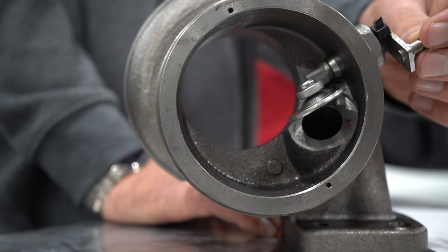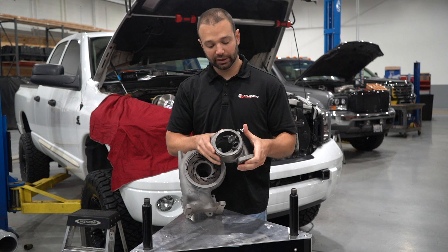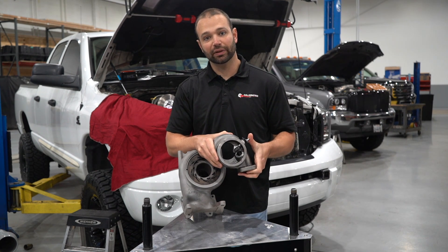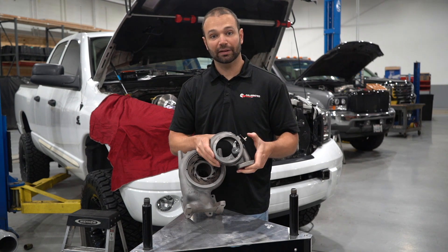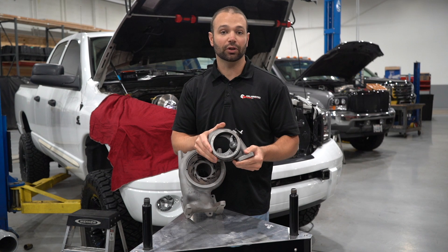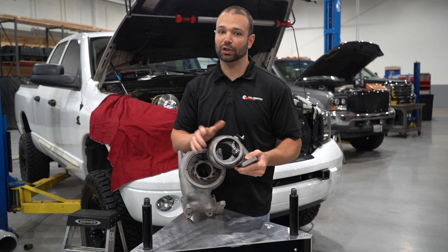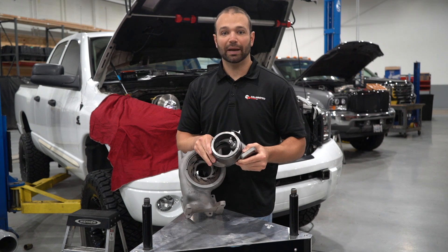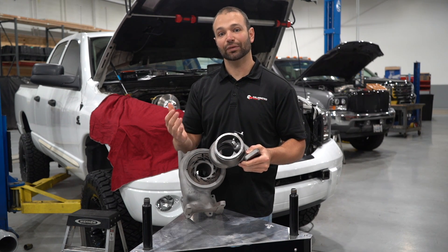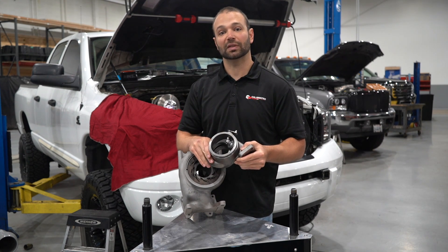On the Cummins, you have a wastegate option — and you have control over that wastegate. I like to recommend opening it up slightly: stock is seven-eighths of an inch; you can take it up to one inch with a one-inch ream, and that works slick. I like to put a big turbine on the small turbocharger to get all that extra exhaust flow on the small side. The only time I recommend hybridizing turbochargers — running a Stealth 67 G2 with a 64 front — is on a compound kit, because you get that quick spool-up and all the benefits of that small 64-millimeter wheel, but with the big high-flowing turbine side. That works really slick.